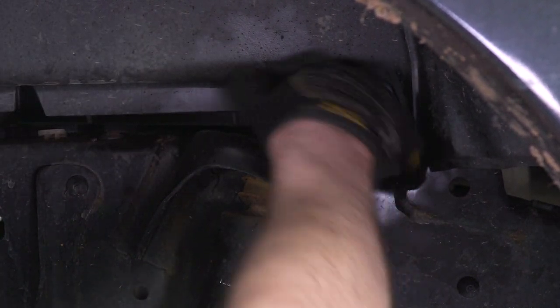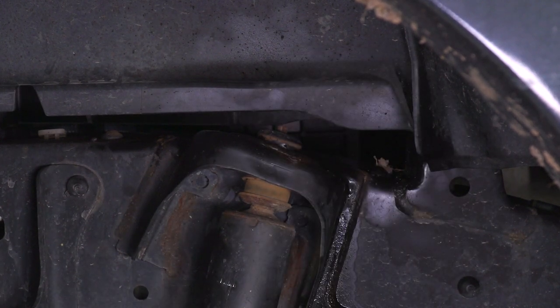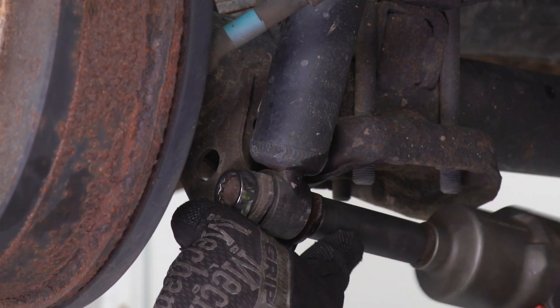And there you go. There's two nuts on there, they're a jam nut. The other one got away from me, but just goes to show you a little bit of prep work, the right tools, and a little bit of know-how make quick work of any rusty nut. Now we can use a 17 millimeter wrench and socket to remove the bolt out of the bottom shock mount.